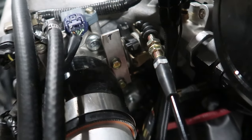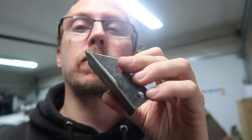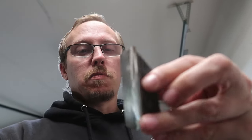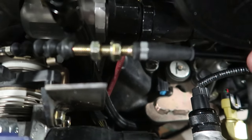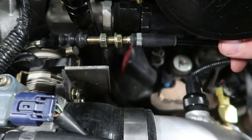There's part one — two more pieces to go. We've welded it together and I flapper-wheeled it down — grinder and paint makes me the welder I ain't, if you've never heard that one. I also had to notch out a piece a little bit with my Dremel using carbide bits just to get some room around the coupler. Now we need to figure out the last piece, which is the dropout. You can see it's pretty much lined up where I need it to be — right about there is where I want it.